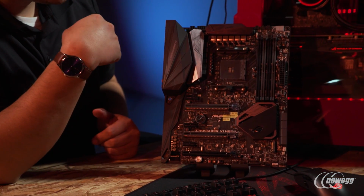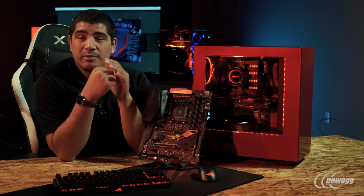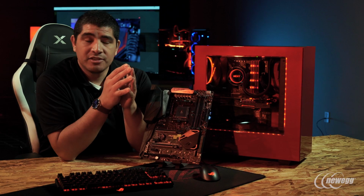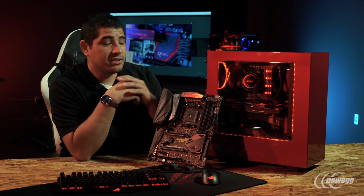The disadvantage of that is most of the times when you talk about general game load, the games, especially with this type of cooling solution, you're going to probably have your CPU sitting at around maybe 40 to about 60 degrees, even under the most demanding type of games. So if we actually take a look at the GPU temperature, even with a very high performance cooling solution like we've got on the Strix, we might be looking maybe about 70s, maybe the mid 70s in terms of the temperature performance. Although I'd say with a great amount of airflow here, I'd probably say that we're probably looking just about 70 degrees under full gaming load.